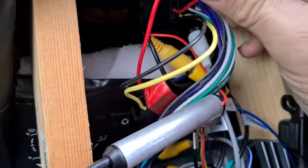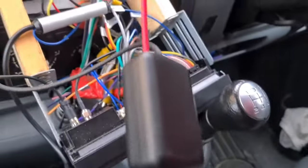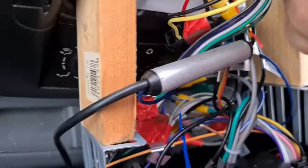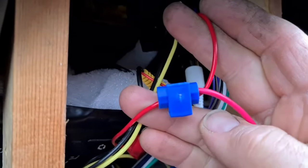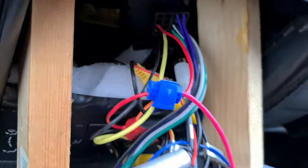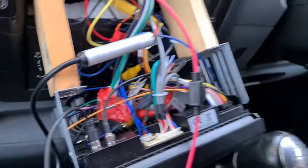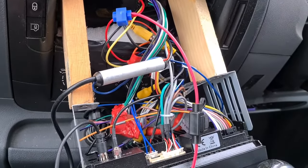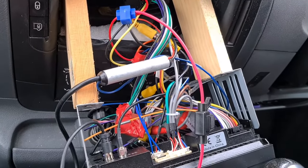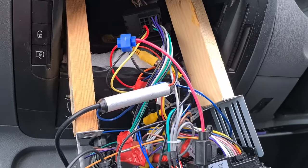Right, so I've attached everything. This is the wire with the fuse that goes to the amplifier, and then you've got the red 12 volt switched live wire with it now. I've used the connector that came with it - this is just to show you that everything you need is in the pack. So now when I put this radio back, I'm going to show you that 102.8 signal is back, as it should be.